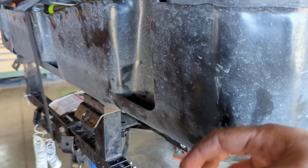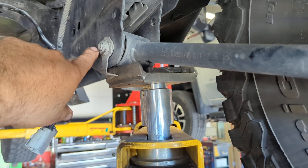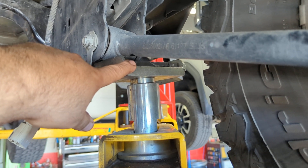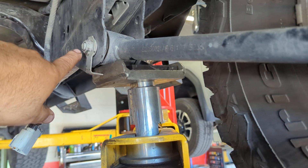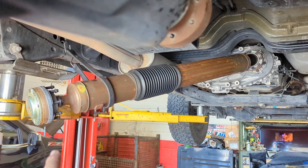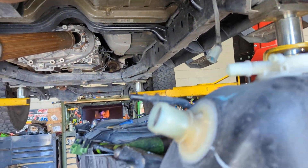It's got a steel bottom, a plastic-steel coated kind of thing. See this bolt right here — it stuck out so much that the fuel tank wouldn't come down, so I had to move the lift over halfway and then back that bolt out so the fuel tank would come down. Real pain in the ass. Just disconnect the rear of the drive shaft — you don't have to take the front off. And then you've got two lines in front.